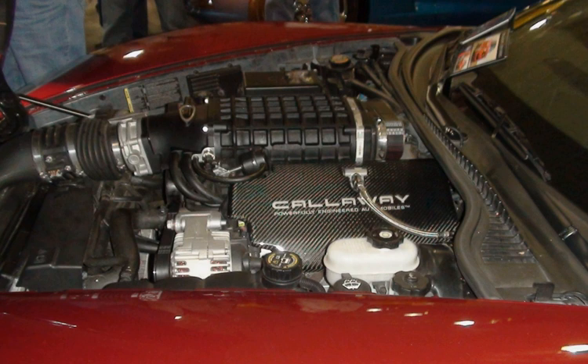In 2010, the LH8 was replaced by the LH9. The LH9 was upgraded with variable valve timing and flex-fuel capability. The Vortec 5300 LH9 produces 300 horsepower at 5,200 rpm and 320 pound-feet at 4,000 rpm. It has a displacement of 5,327 cc (5.3L, 325.1 cu in). The compression ratio was 9.9:1 for 2010, but was reduced to 9.7:1 for the remaining two years of production. LH9 applications: 2010 Hummer H3 Alpha, 2010–2012 Chevrolet Colorado/GMC Canyon.